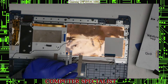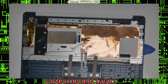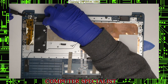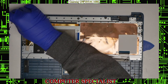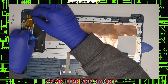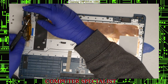The only things really left are the speakers, which pull straight out — they're just held in by tape. There's also one on this side held in by tape. Then we have this side IO board. Before unscrewing it, there is also a speaker plugged into it that can be unplugged. Then we have three screws holding the board in, plus a big connector on this side — lift up the black tab, the cable pulls right out, and then you can just lift up this board and that's out.